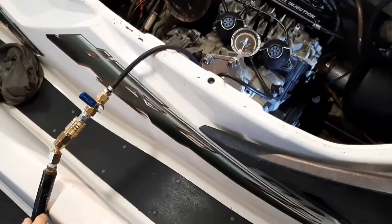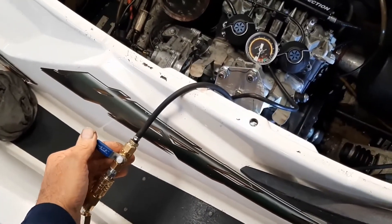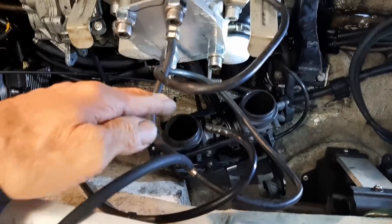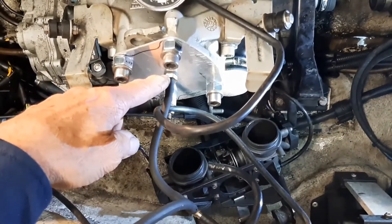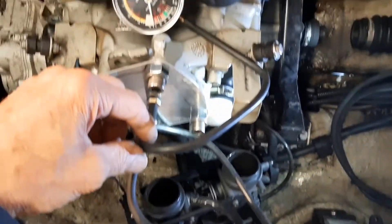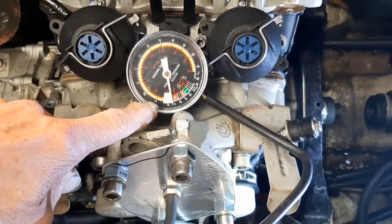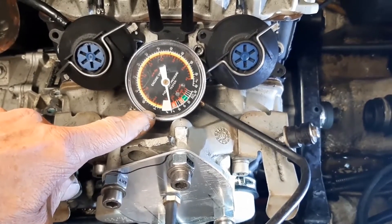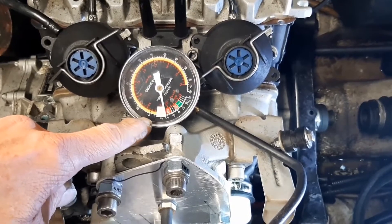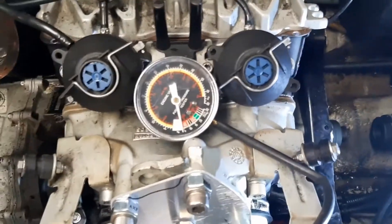Here I have shop air, and the air compressor regulator is set at five psi. I've got a shutoff valve, and that is teed to a line going into my blank plate. On the other end of the T, I have the gauge. I had to get a lower reading gauge so I could see five psi better. Normally your compression test gauge or fuel pressure gauge is going to be around 200 psi, and you're not going to be able to see five psi very well.